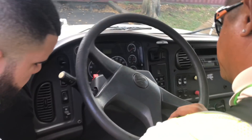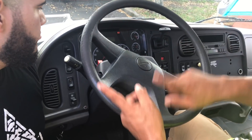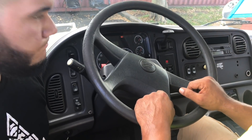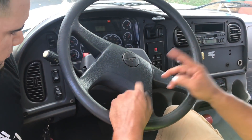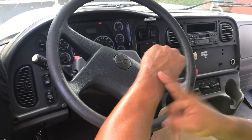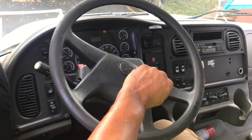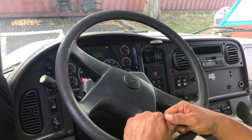When you shut off your engine, turn your key back to the right. Your gauges are going to light up and go forward, then go back. When they go back, that's your cue to begin your LAB test — which stands for Leaks, Alarm, and Buttons. Press your brake for one minute and you should not lose more than four PSI. Also be listening for leaks. Make sure you have a wristwatch and count out the full 60 seconds. Examiner, I do not hear any leaks. I did not lose more than four PSI.